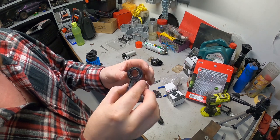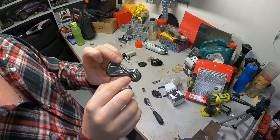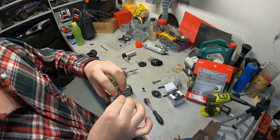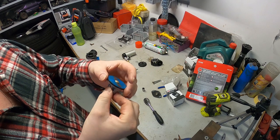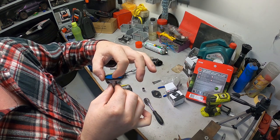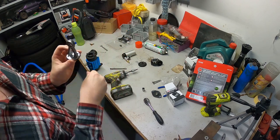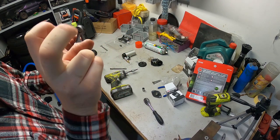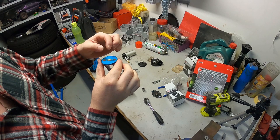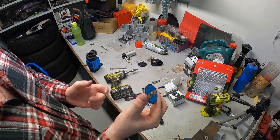In this lower bearing there's plenty of grease in it, but I'm gonna chuck another little dab of grease in here because this bearing actually dries out over time. Just gonna chuck a little bit of my green grease in it and put it all back together. This seal here is fine, but if you do have any nicks, cuts, or tears in it you can buy a replacement seal from ARB. These little valves here are another replaceable part. The air is drawn in through the filter into the crankcase, goes up through these little inlet valves, and as the air compresses those valves stay down and it pushes air through the cylinder - very simple design.